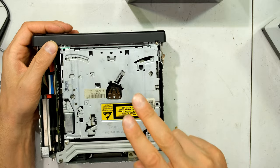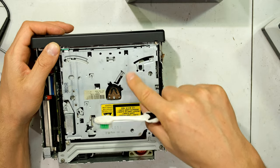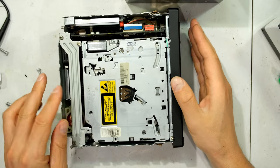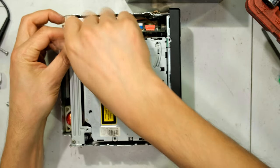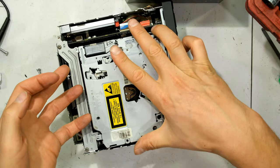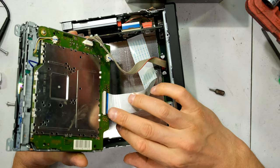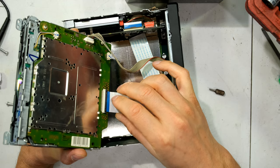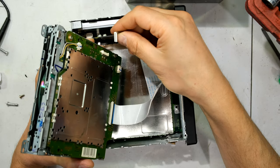To eject the CD you must have it plugged in and press the eject button. I removed the CD, put some thinners on, and cleaned all the moving parts — the oil was here and here, so cleaning it allowed them to move freely. I did inspect inside by opening the entire CD tray — this is a T7 and there are four screws. Once you've removed the four screws you can lift the CD tray out. There's the CD module with a ribbon cable and another cable — pull both sides and you can remove the ribbon cable. I'm not going to remove it in this case.